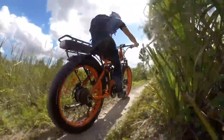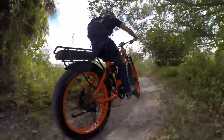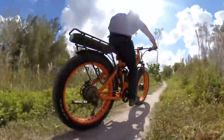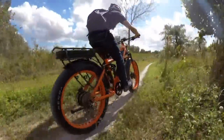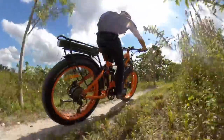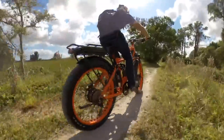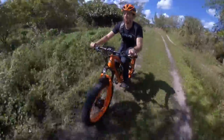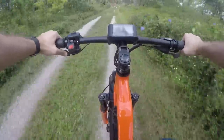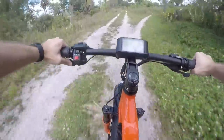Now go to lift the bike into a truck at the end of the day, and that's where the 90 pounds of the Super Monarch is gonna be a bit more of an issue. For me, though, I found that with 1.5 kilowatt hours of battery, I could just ride the bike to any trails I wanted to enjoy, instead of having to truck it there. Then I'd spend an afternoon ripping around through nature, and somehow I'd still have plenty of battery to make my way back home. And that's the benefit of carrying an extra battery. The bike is always drawing from two batteries, meaning you don't just get twice the capacity, but the batteries actually run cooler and more efficiently since they don't have to provide as much power — unless you keep it in all-wheel drive mode all the time and rip through the trails with reckless abandon. But I never even got close to running through both batteries on a single ride.